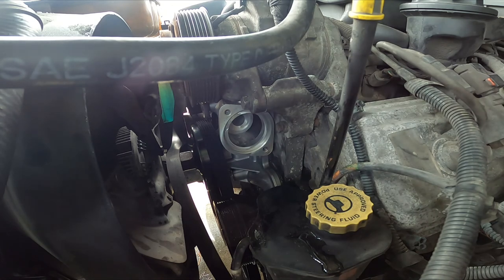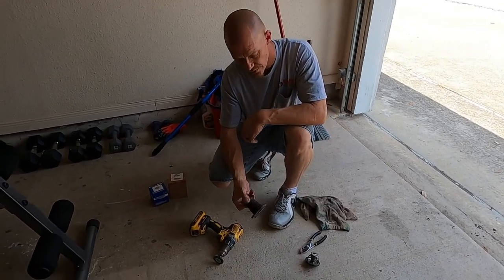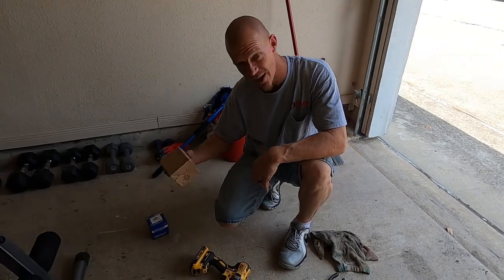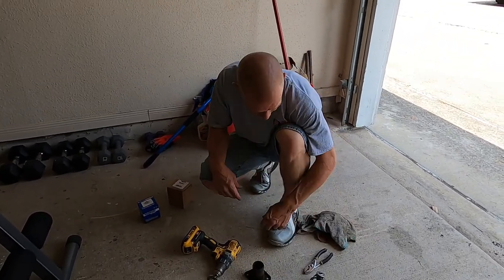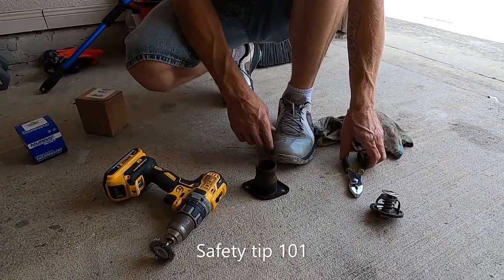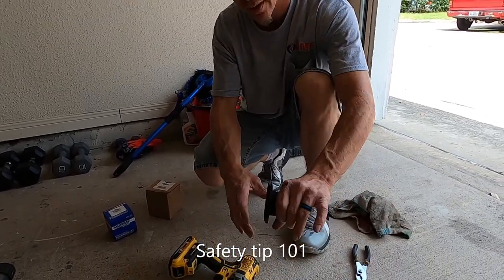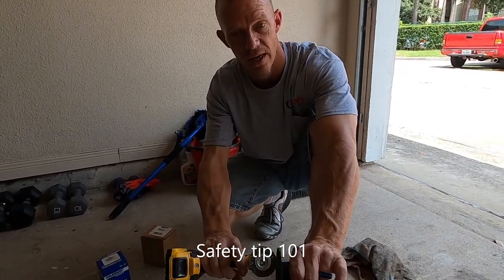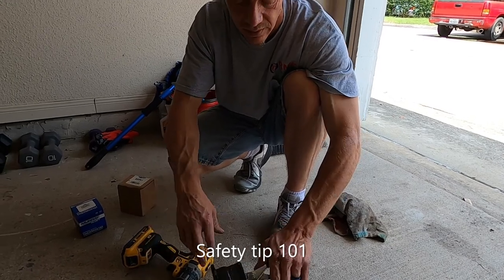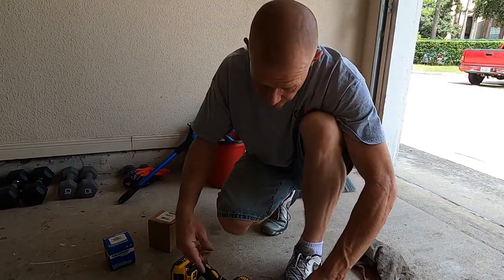I've got to get this camera unfastened from the truck, get you over to the garage, we'll clean that housing and get going from there. I was looking at my thermostat housing — it's the original, I've never replaced it. I'm going to show you how we clean it up. I already went down and bought a new thermostat and a new housing — I'll show you why after further inspection. Two things I want to note: I'm going to clean the surface with a wire wheel. First, don't use gloves — you don't want the wheel to catch a glove and take your hand with it. Personally, I don't feel comfortable holding it that close to my hand, so I grabbed a pair of pliers — I feel a little safer that way.